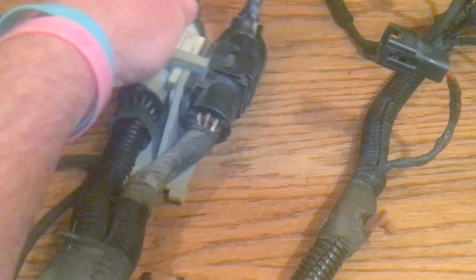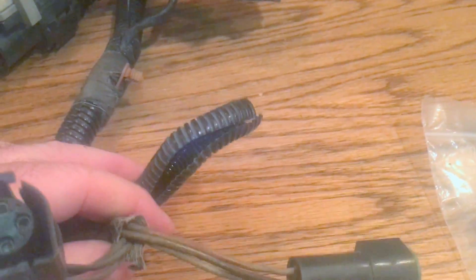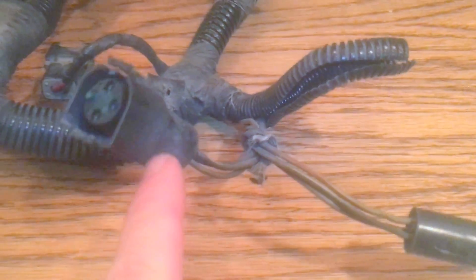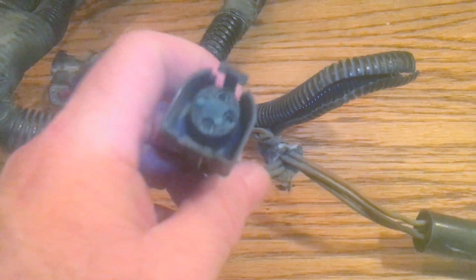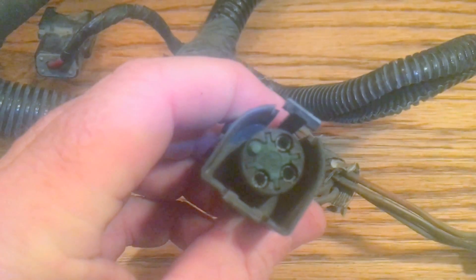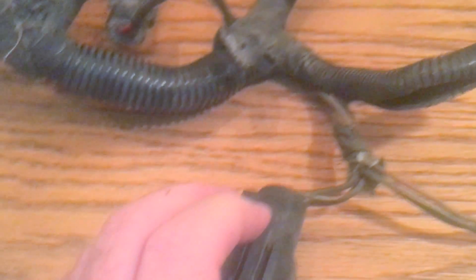This is your salt and pepper shaker. We just move this out of the way, and you'll find the little branch that sticks up. Along here would be your throttle position sensor, which you're going to leave. That's your connector to your TPS. And then your EGR, which is co-located with your throttle position sensor on the upper plenum. Now this one is a three-wire connection. There's three ports that we deal with.